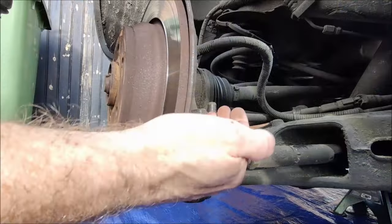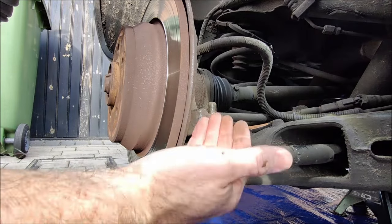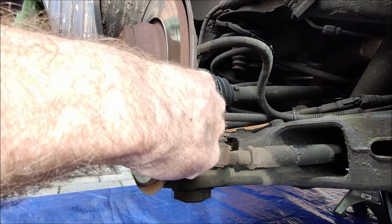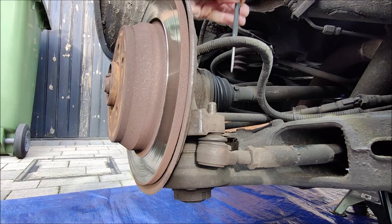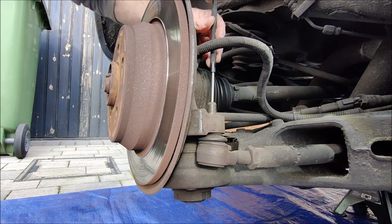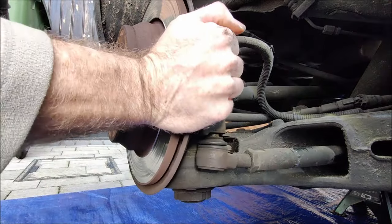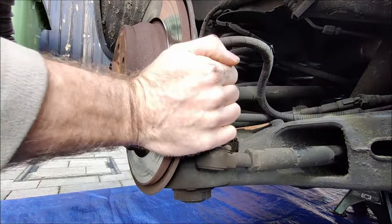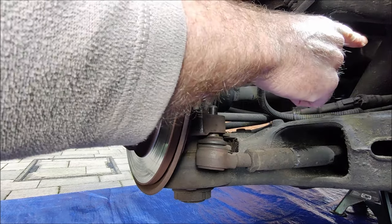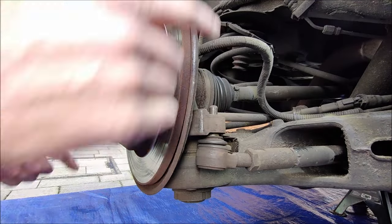The bolt's off. This fitting is a taper joint, so even with the bolt undone it's still in there quite firmly — you have to knock it through. Don't hit the head with a hammer because you'll burr off the top and won't get the nut back on. Put a punch down into the Torx bit opening and just tap it through. We've just loosened that up enough to give the hub a little leeway. If needs be, we can go to the other end of the actuator and release it from there if you don't get enough slack.